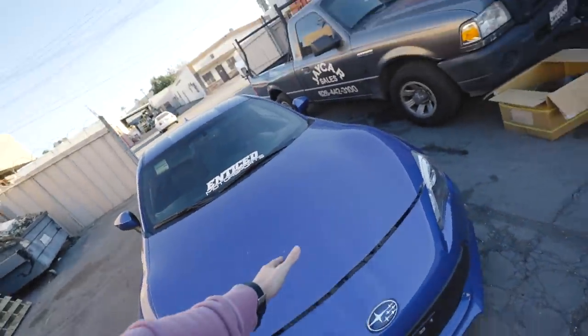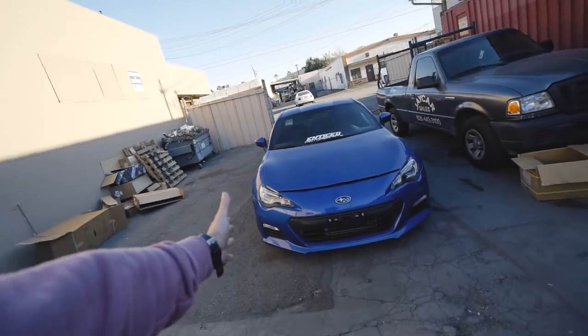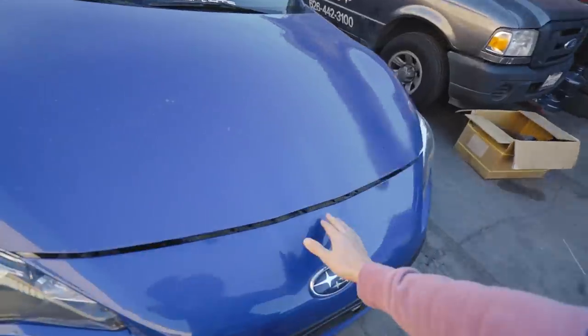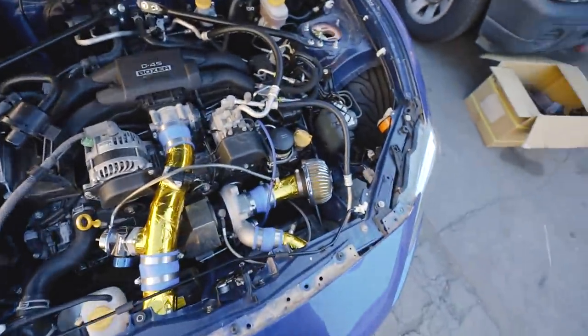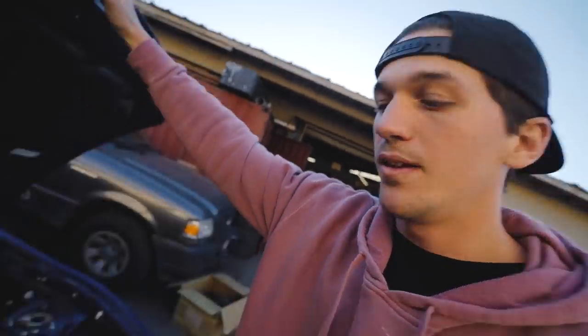Just to be 100% sure, because I'm trying to figure out which way I want to go — this kit really doesn't push enough boost to make it matter either way. I'm trying to decide whether I want to run the blow valve or just go straight turbo surge. What we're going to do is disconnect the blow valve. Once it's disconnected, the spring is not going to open and it's going to be all surge, so I want to see what that sounds like and then make a decision on whether to block off the blow valve hole or just leave it. Keep in mind this is just temporary until we install the boost controller, the map sensor, and actually get a tune. The tuner I'm going to use for a base tune is currently in Belize and gets back next week.